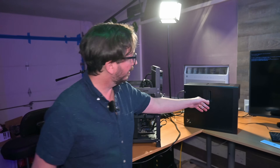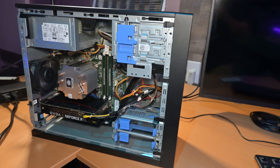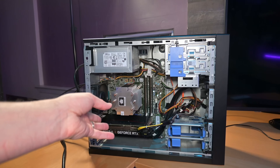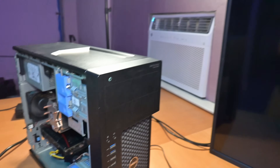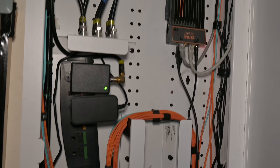Our new build is running right now — you can see it over on that 4K monitor I use as the debug TV. This is the build we just put together: the $350, 12 gigabyte VRAM 3060. It's actually a really decent little machine. These are all Proxmox-based, which gives me a lot of flexibility, and I have a lot of Proxmox nodes. To maintain quorum on all of these devices you actually have to have quite a few. With Proxmox, I think the limit is 15 or 16 devices that you can have joined together into a cluster.